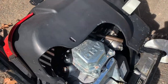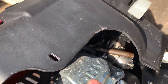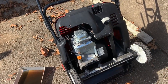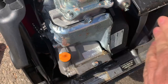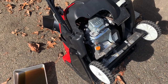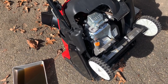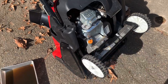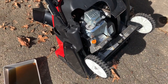You can also see on these Toro engines the vent tube is actually coated with oil on the end. These valve covers — if you tilt the snowblower back, a lot of people tilt them back to put them in their cars and trucks. The problem is when you tilt them back, this thing fills up with oil and goes through this hose and pours all over the place. You're not supposed to tip these things. If transporting them, drain the oil out first, or plug that hose so it doesn't leak.